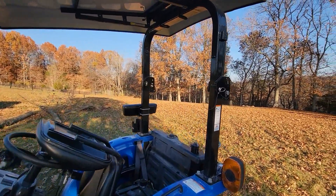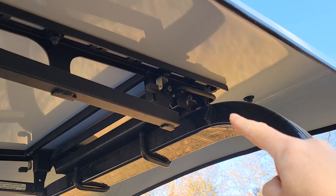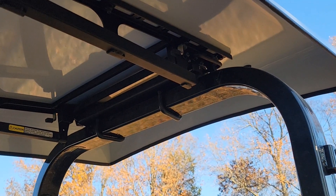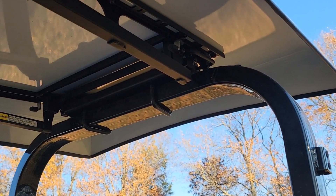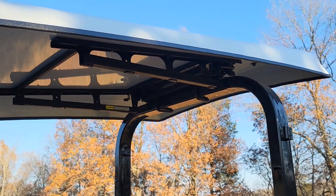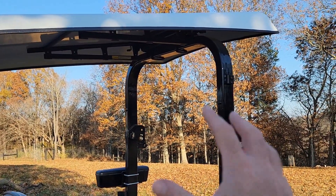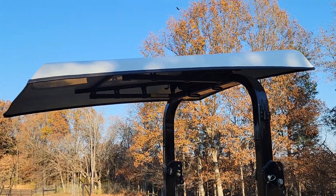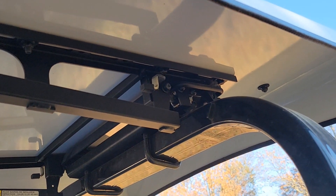You can see how the front of the canopy keeps sagging downward. Let me zoom in a little bit where the hardware is up there that holds these bars. I have gone in there and tightened those down as much as I can. I guess I could put some thread locker in there and try that, but I really didn't want to because the whole idea of this canopy is that it's supposed to be quick-disconnect — you can take the whole thing off your roll bar very quickly.